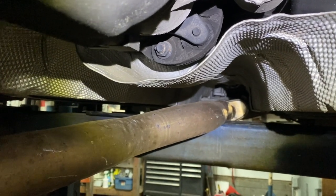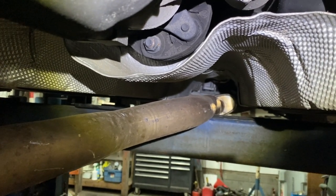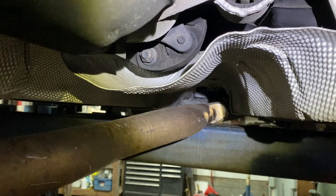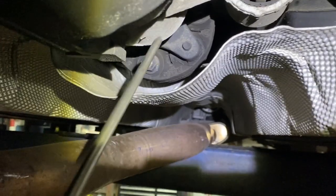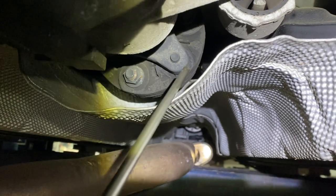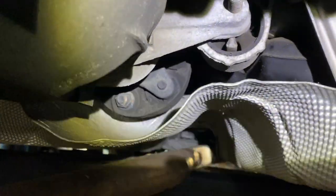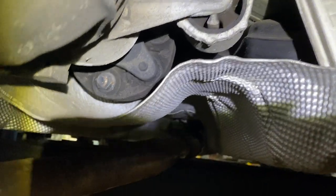Hey guys, MotorConner here, and today we're going to be addressing an issue if you have a drivetrain on your BMW, late model 2012 and up, all wheel drive, X-Drive models. If you get a shake or vibration or the car just doesn't go — you're stranded — it could be as simple as this rubber flex plate right here. This connects the driveshaft to the transmission or the driveshaft to the rear end and has a rubber mount to make a smooth transition and make the car enjoyable to drive. That's probably why you drive a BMW, but these things fail.